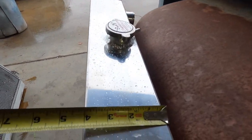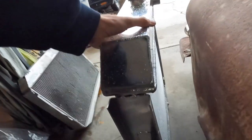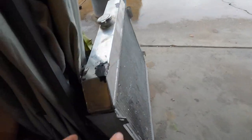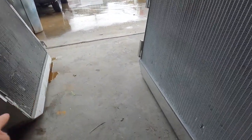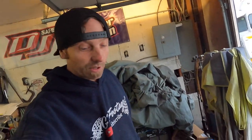I love the tank volume too — there's some added volume here. We've got a four-inch tank on the new one versus two and three-quarters on the old one, so the amount of volume we're going to pick up alone is going to be phenomenal. The width of the radiator itself is pretty well the same — it's a three-row core — but the tank has overhang, that's just added volume and added water. The top tank is going to give us a lot of volume, and the surface area plus water volume are basically how it cools the motor.